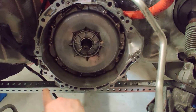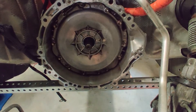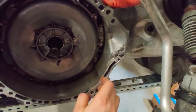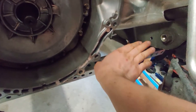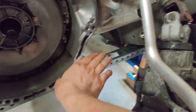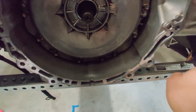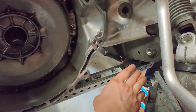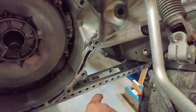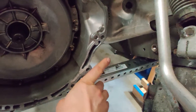Currently I have the transmission supported by a steel square tube so I could take precise measurements. It is located exactly in the spot where it needs to be, and on each side we have those massive bolts which support the front subframe. They are kind of in the way, so I decided to use them — they are very strong, so I may as well use them to support this transmission mount. I'm going to run aluminum angle from side to side and bolt it to the frame.